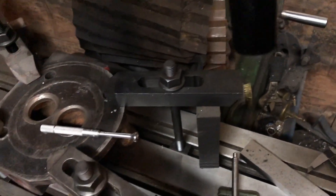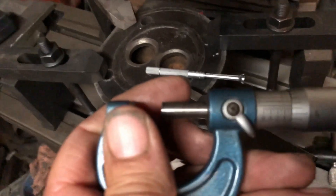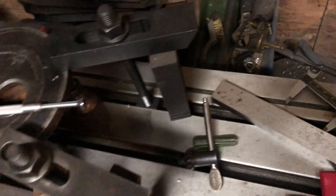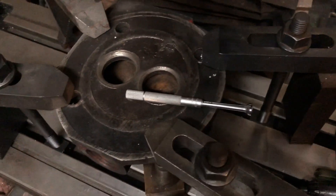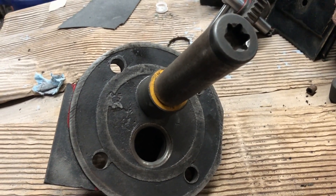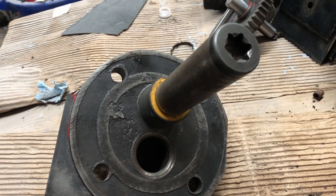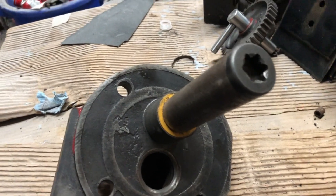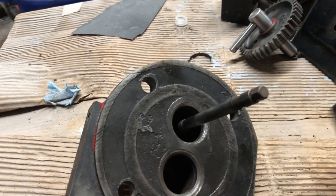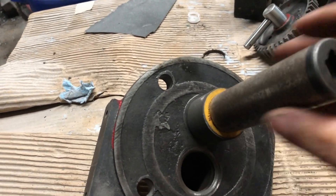I go to measure it — it's on 0.406, right on what we want. Now we'll have to go make a valve for it. Since the valve guides are done, I've got a pilot shaft already secured. That way I can grind new valve seats.